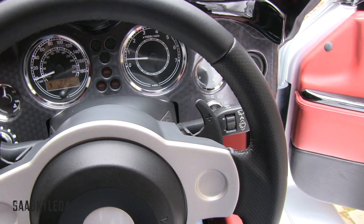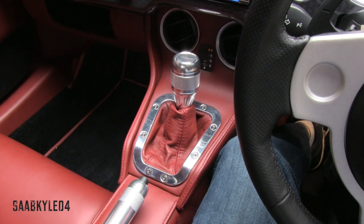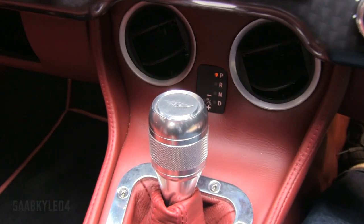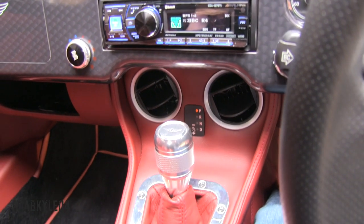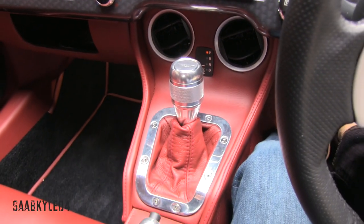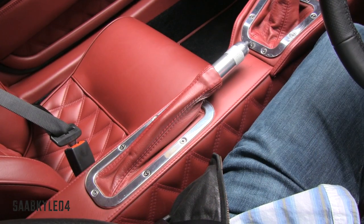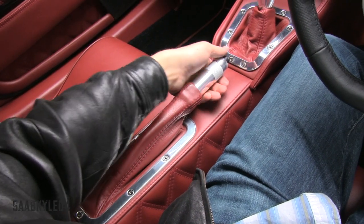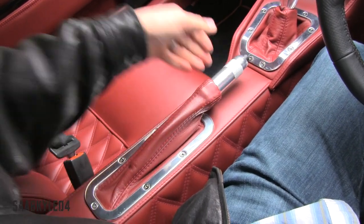The automatic gearbox seen here has 2 modes, Sport and Auto. While in Sport mode, gears are held all the way to redline, while throttle blips on downshifts aid smoothness and acceleration responsiveness. Thanks to a special lock-up clutch, low power loss design, and relatively quick gear changes, the Auto is a few tenths of a second quicker to 60 than the manual. You can even shift the car manually via the bespoke gear lever or by the steering wheel mounted paddles.